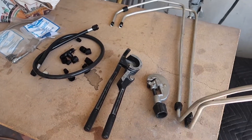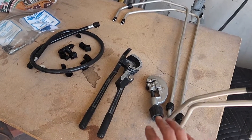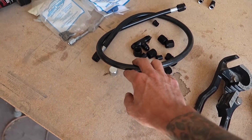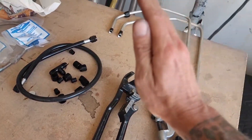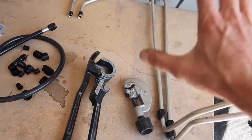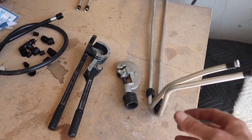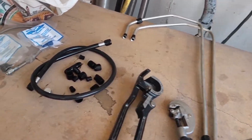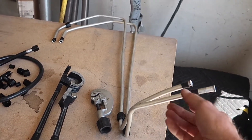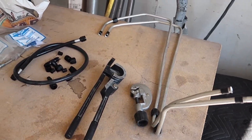For all you guys that know about this, you can skip it. For those of you that don't - this is aluminum tubing, otherwise known as hardline. I use this for fuel. I have a softline like this that's a jumper that goes from the frame up to a bulkhead. And then where it's mounted to the motor, you can run hardline because it moves with the motor. As soon as it's on the motor and it all moves together, that's where the hardline comes into play. Looks nice, gets the job done, keeps everything where it's going to go.